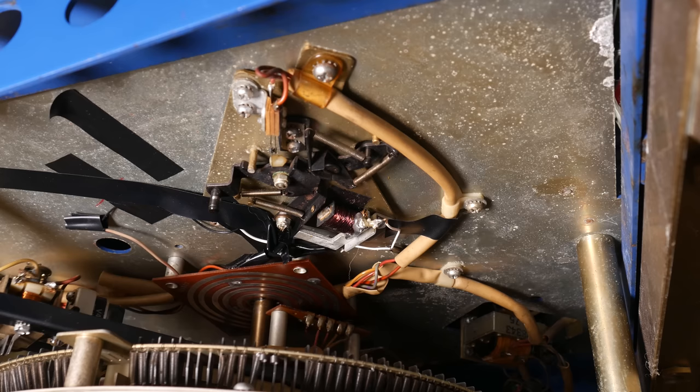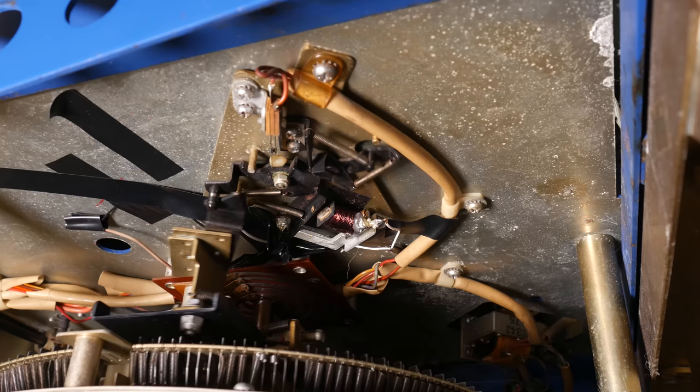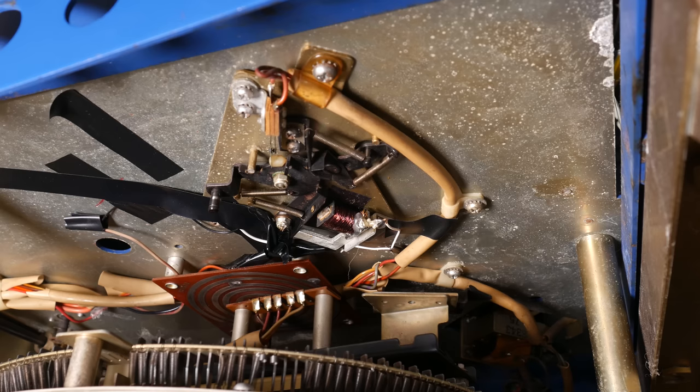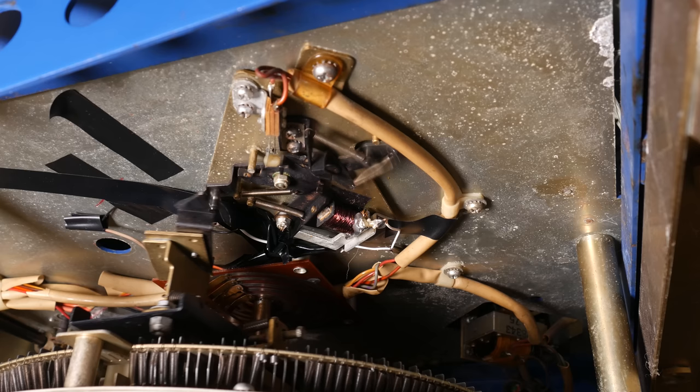You can hear a loud click here. That is the carousel hitting that mechanism. This occurs right when it's on the record position A1. The first time it hits this mechanism, the carousel just keeps rotating, and that ensures it's going to make another complete 360-degree search in case there is a selection that was made behind the one it was just playing. But when it gets back to the home position the second time, it will in fact shut off.